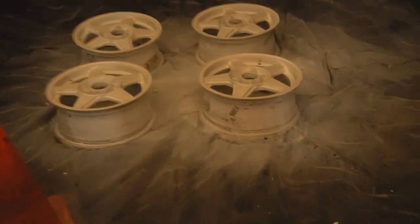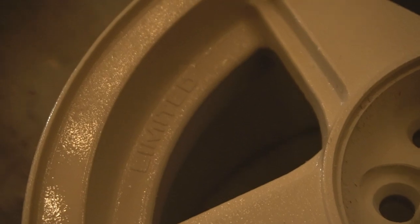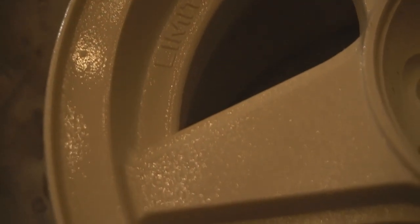Load them up, take them home, and I'll probably film little snippets of the painting process tonight. I may or may not have forgotten to film this whole time. I tried to sand down a lot of the remaining paint and chip it off to bare metal, get as smooth as possible. Did a layer of primer, two or three coats of paint so far. I devised a genius little rig to paint the barrels — putting the wheels upside down and slipping a traffic cone through the holes in the center, then painting the inside barrel that way. I just did a coat, they're still very wet.